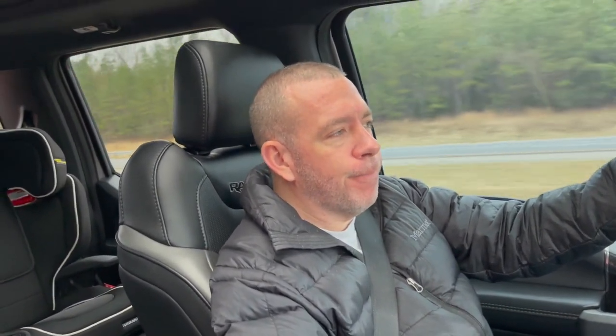I've been running this stretch of road in sport mode over the past just to get a better feel of it. I actually just like the way sport mode feels on the highway. In sport mode, these Fox shocks are live valve, meaning that they're active and always making adjustments to the conditions — primarily, for these examples, the road. Having sensors throughout the truck taking inputs on braking, turning, acceleration, and maybe a few other things, the computer then sends back a signal to make the appropriate adjustments for maximum performance in that very moment.